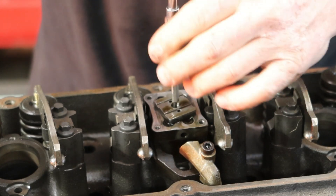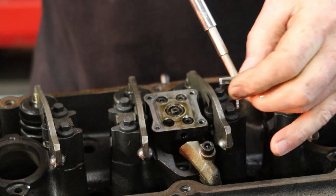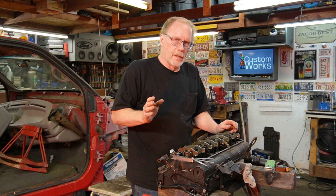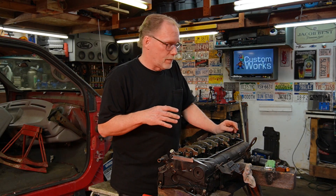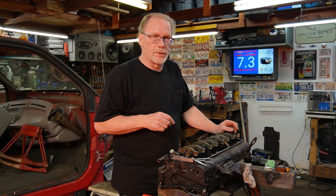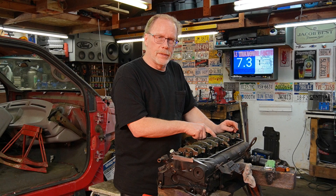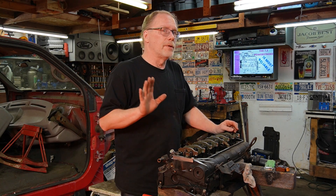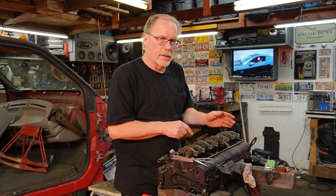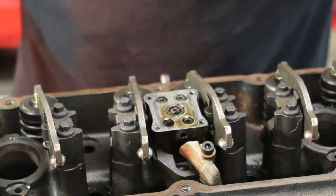Let's get this off of here and set that aside. Now once again I haven't opened this up — this is an injector that came out of this engine, the ones I am rebuilding in the injector series. Notice that the poppet is sitting in the correct position. When it's sitting the long way it's the wrong way — it's got to be sitting like this. This one is a little bit off right here but we'll get that corrected shortly.